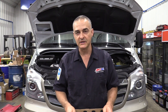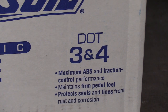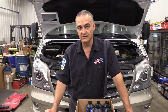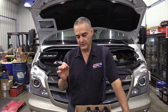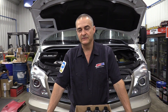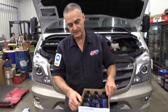The reason we're doing this brake flush with Amsoil fluid — it offers maximum ABS and traction control performance and maintains a firm pedal feel. I've done several 2018-2019 Toyotas where the pedal feel was really firm after I did this, even though the fluid didn't look bad at all, but this fluid gave it a more firm feel. It also protects the seals and lines from rust and corrosion. Your ABS brake system is very expensive, and if moisture gets into the valving and starts corroding it, those are very expensive items to replace.